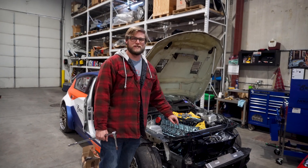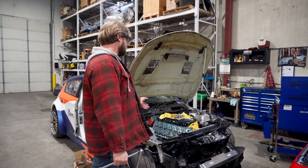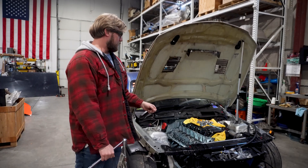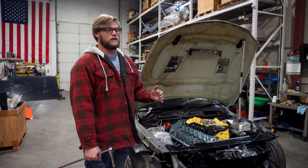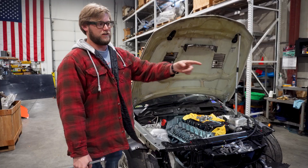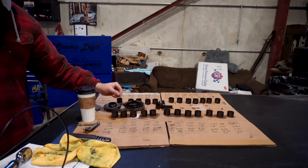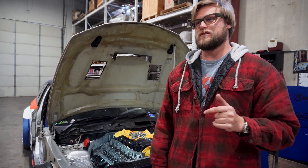We're back from South Carolina and I have time to mess with this. We were on the dyno right before we left and we had a ton of valve noise. Before the dyno, I adjusted the shims to all be more even because they were a little all over the place — shaved down a couple. But then we looked further into this because it still made noise. The cam sheet — the first line says the valve lash — but only one valve was in spec after checking them all. You want 7 to 8 thou, 6 thou if you're feeling a little frisky. We had mostly 9 through 14 — double the tolerance required and stated on the sheet that goes with the cams.